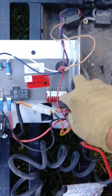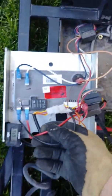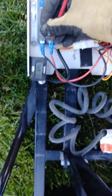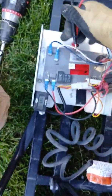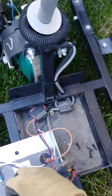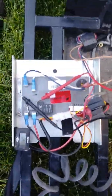Put the connector back on — clicky click. So motor's good, battery force is good. Now let's go back to the voltage reading and find out if we're getting power to the switch. The way this works is there's a little rod right here that moves up and down — that's how you control forward or backwards. This is basically a little potentiometer. You've got your over and back, and the source comes in and transfers over, but with such a small wire I'm thinking it sends a small signal voltage back down to here.